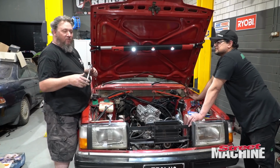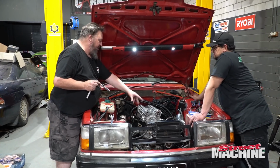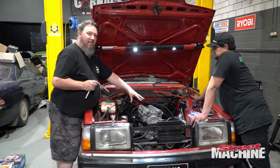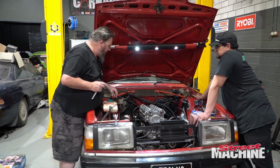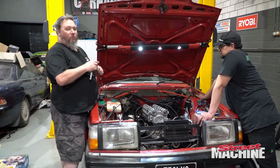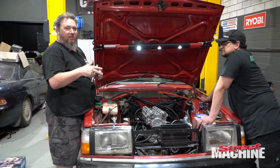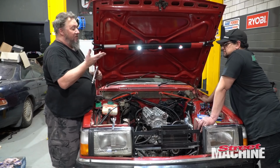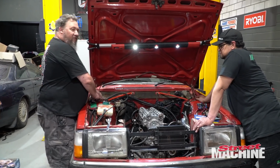So what I was doing then was the lobes that were up were releasing the tension off the caps, then retensioning the caps. So that was the first 2 caps and number 6 because the lobes are up. And then we'll rotate the cam, bring other lobes up, release those caps, retension those caps, because this is the way to do it in the Toyota manual. So we shall follow the rules.